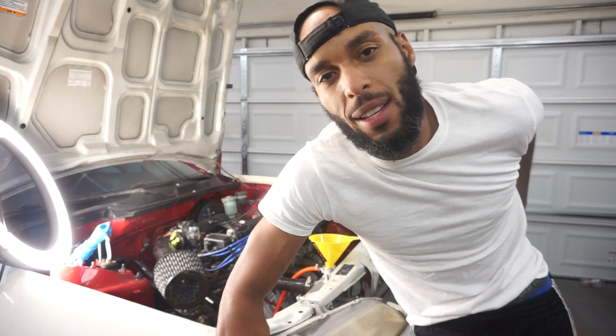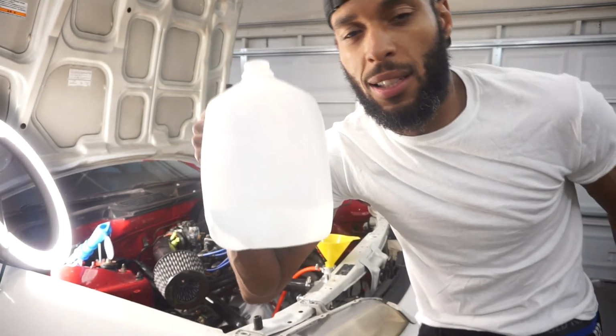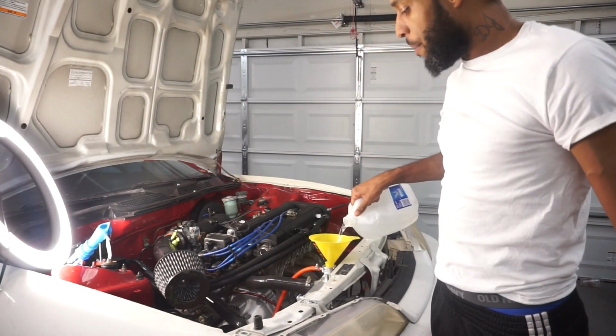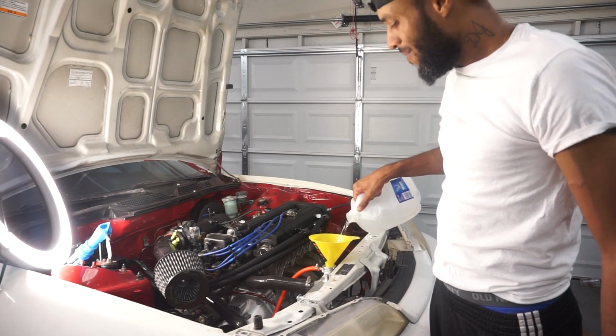So that's one of the things that using tap water will cause. It'll just eat away at plastic fans sometimes. It'll just eat away at your system. So always use distilled water when you're using water. Water should be temporary anyway. So another tip,